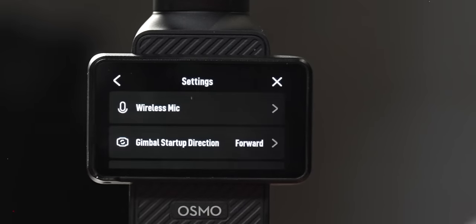Next to that is the zoom feature — click the 1X and a bubble pops up; push up to zoom in and pull down to zoom out. In the lower left-hand corner there are three dots for your advanced features, including Pro mode. Turn this on and a bunch of options pop up: grid, focus mode, white balance, and color — you can switch it to 10-bit.